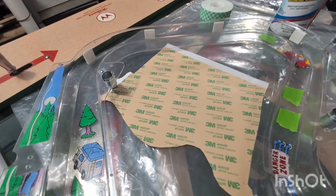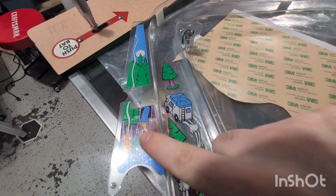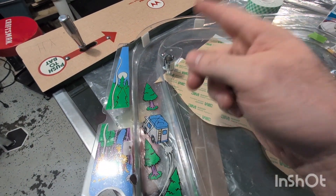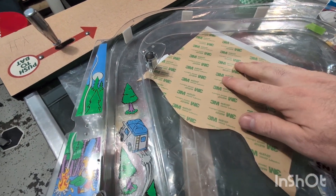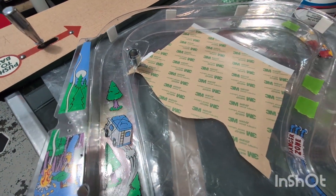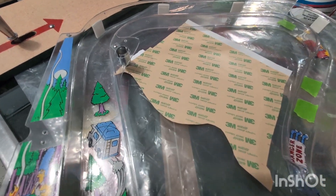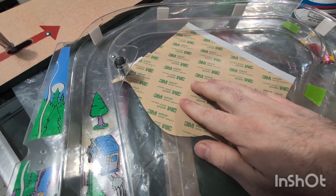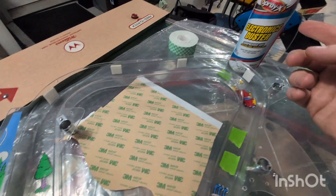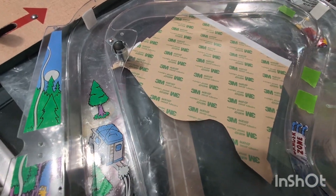Some other tips that I don't think Jody covered in his video because he didn't screw up. I was working with one decal — I had it peeled off and these decals are really flimsy. This one kind of curled like a ribbon and was hard to lay down flat. The first time I tried it I got a crease in it, and I wasn't sure whether to lay down the rest or peel it back up. Then it dawned on me — if I made a mistake I can just spray it back off. So if you make a mistake, just stop, don't let any more lay down, do more freeze spray, take it off, apply new adhesive, and start over. It worked great — I just had to do that one twice.